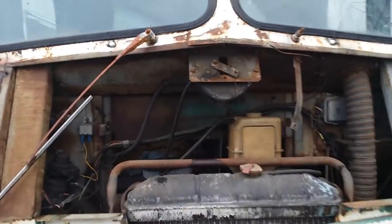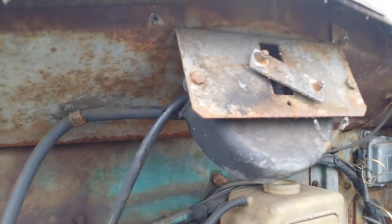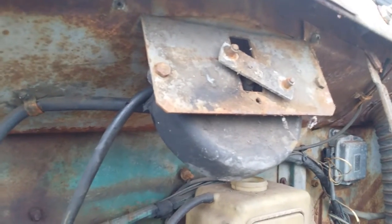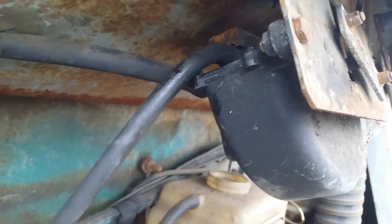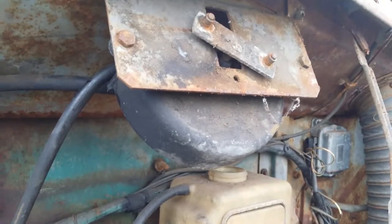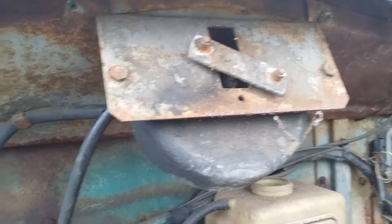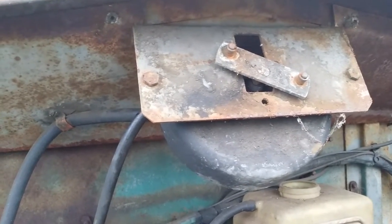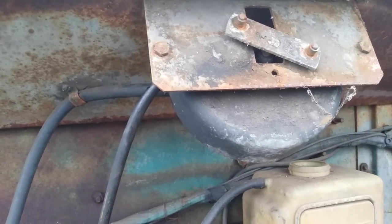We're working on the wiper system. This is a vacuum-operated wiper motor, and yesterday I fiddled with it for a while. I shot some ATF inside where the vacuum hose connects and let that sit a little bit, and eventually got it working just by hooking the hose straight up to manifold vacuum, which in most cases in a lot of cars, that's all there was. I've had vehicles before that had a vacuum pump on the fuel pump, and those actually worked okay.